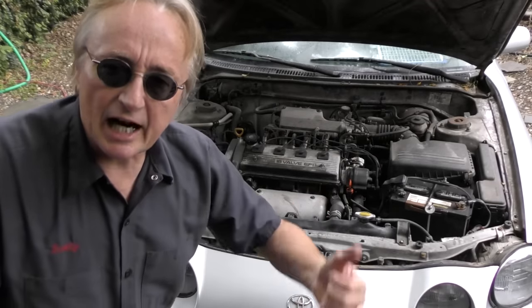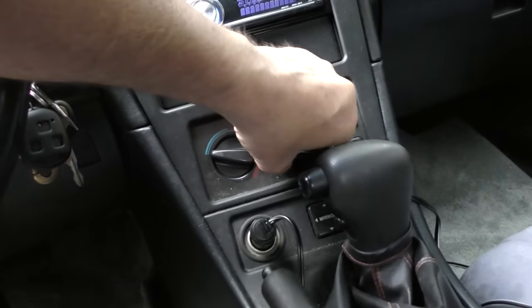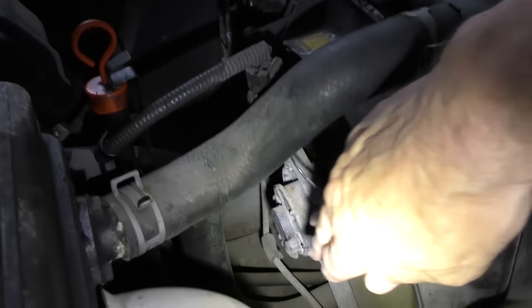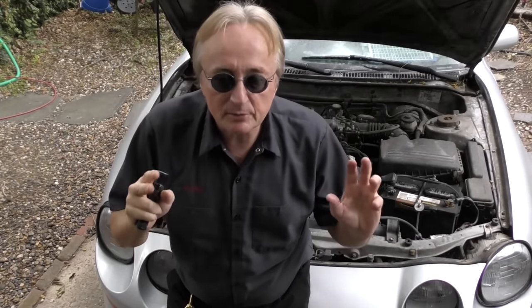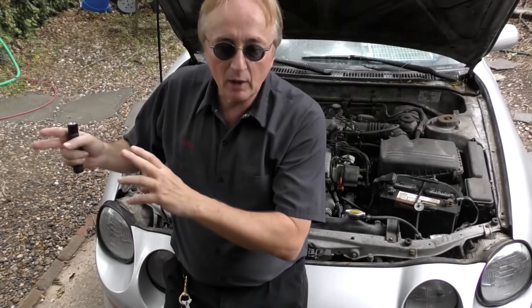The next thing to check is the cooling fan. This car has two cooling fans, so turn the AC on full blast and check the fans — this one's blowing and that one's blowing, they're working fine. Turning the AC on will make all the fans run after a few minutes. You've got to make sure both fans work. I've had many customers over the years with one fan burnt out and the other working fine — and even though the car seemed okay, it was running too hot. You don't want to strain an engine by having it run too hot just because a fan motor wasn't working.